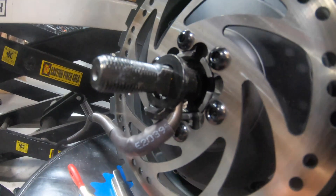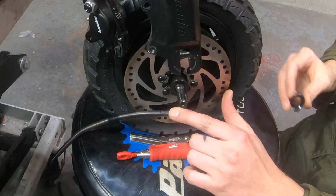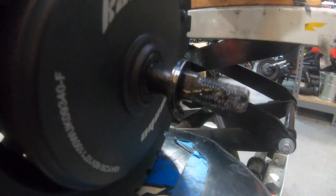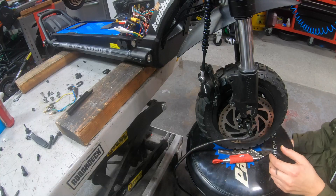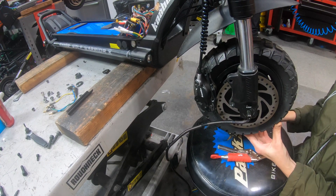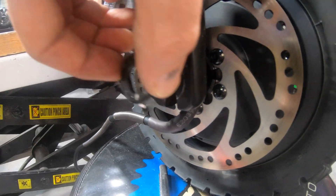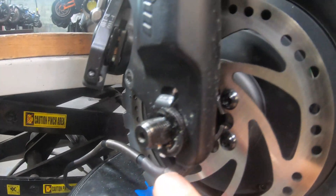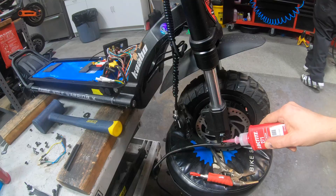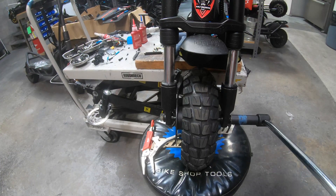When you go to mount the motor onto the forks, it's going to have two of these little flanged washers on either side — with the flange facing down — along with the motor cable facing down. The flange is facing down, the motor cable is facing down, and now we're just going to lift the motor up into the forks. I'm going to use my lift and this stool to hold the motor in place while I add the washers on the outside of the forks. For the outside washers, the flange is going to be facing up and going into this little well here. Now we're going to apply some red Loctite, and you should be able to get the axle nuts started by hand — this will help to avoid cross threading.